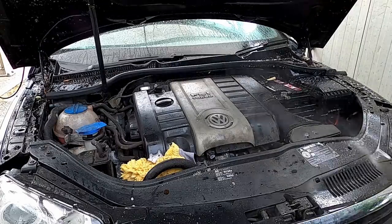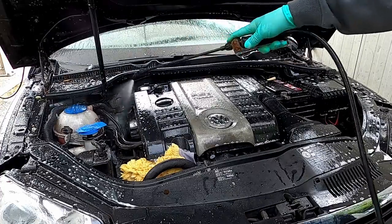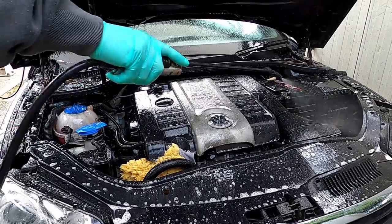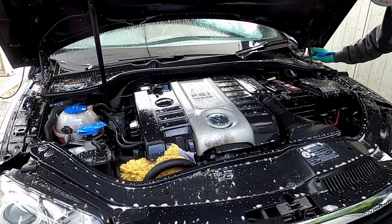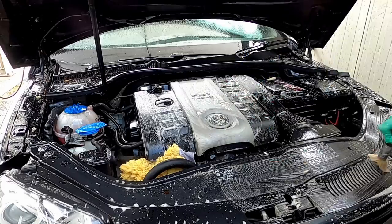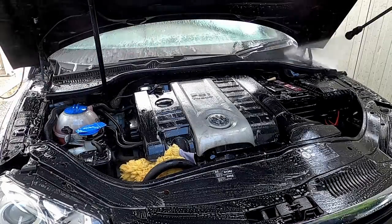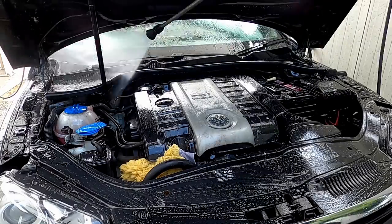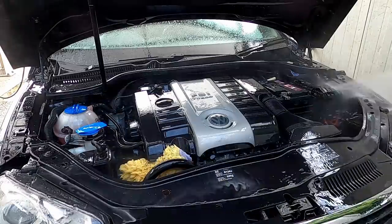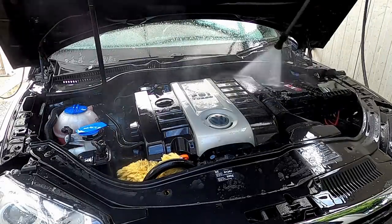With that done I can now concentrate on the engine bay. It's really simple - I'm just going to cover the whole thing with all-purpose cleaner and then use the same brush I used on the bodywork just to agitate some of the bits on the engine and loosen off the dirt before rinsing it off with the jet wash. A keen eye will notice I've shoved a wash mitt over the alternator to stop it getting too wet. On the right-hand side of the engine bay the battery cover is missing because the car had a flat battery and had to be jump started a couple of times. The trick with using a jet wash in the engine bay is just to turn the pressure down - all I'm doing is rinsing off the all-purpose cleaner and the filth it's removed, not hitting anything too hard.